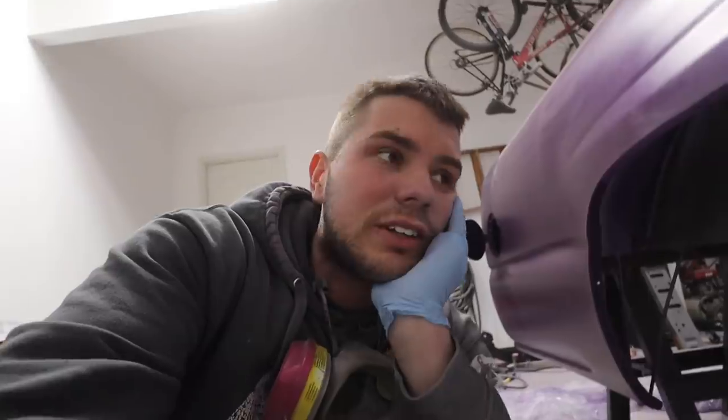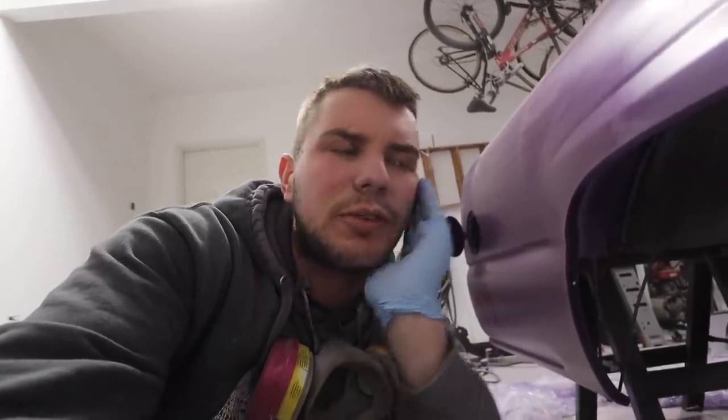I'm gonna finish this up here and get it coated. It's coming out real good. I haven't seen any of it cracking yet. It does look darn good though, so there's a lot of paint in that gun still. And there's activator in it, so it'll harden. One, maybe two more coats on real quick, just so we're good. And when this dries, we can get it all sanded out.